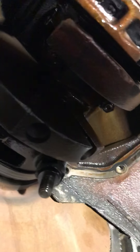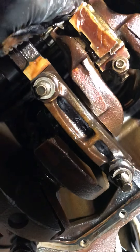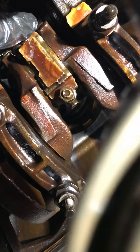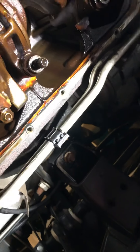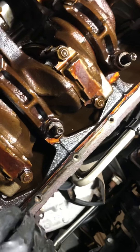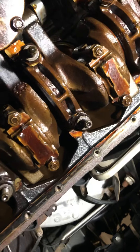Like I've been saying in these other videos, everything is so tight. The connecting rods are super tight — a little normal play back and forth, but even that thrust bearing, I thought that might really make sense. But I get a hold of this crank and nothing moves. I can't even budge the thing forward and backwards.